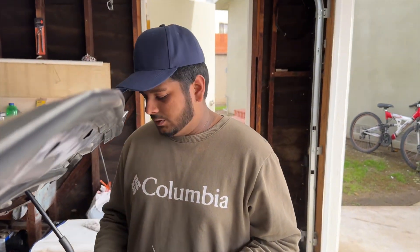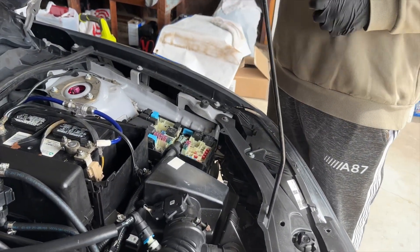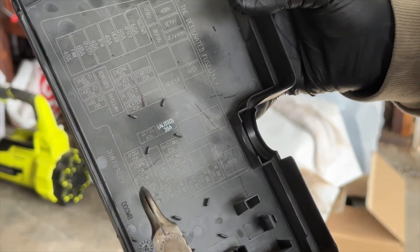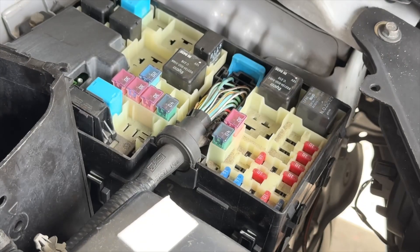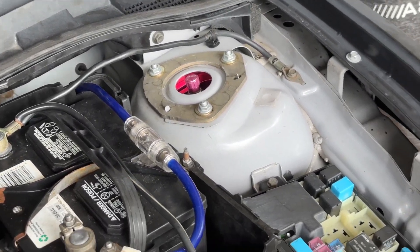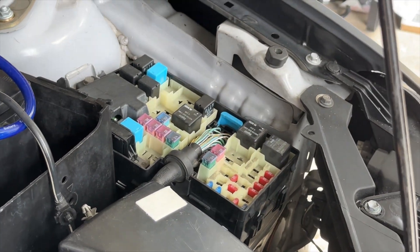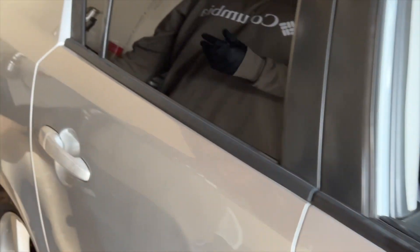The first thing you're gonna do is disconnect your fuel relay. Open your fuse panel — it'll say in the diagram which fuse it is. In my case it's a 15 amp fuse, the third one. You need to make sure there's no fuel pressure in the car, so open the fuel cap and let the pressure out.